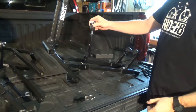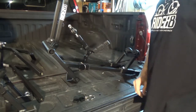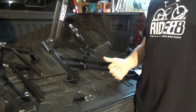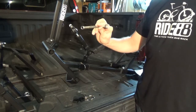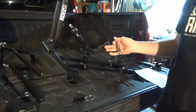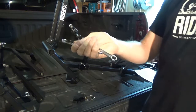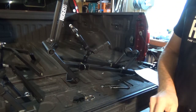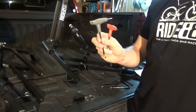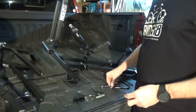Next is mounting the closing arm to the top rail. You have a single bolt in there that needs to be removed. To work with any of the nuts and bolts on this bike rack, you'll need a hex wrench and a regular open wrench. This particular wrench is an 11mm. The two sizes you can use to adjust any bolts on here are either an 11mm or a 7/16. For all the screws, you can use either a 5/32 hex wrench or a 4mm hex wrench — whatever you have available.